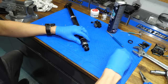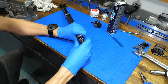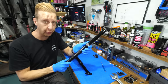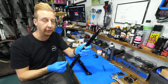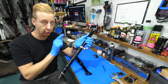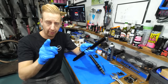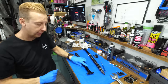Then you're free to put back the remaining parts to hold the cable into the bottom of the post — you'd actually install the cable at this point. That's about all there is to it. It's really quite simple — you just have to take your time and be methodical. You don't even have to go as far as removing all this stuff; you can do option one. But just be aware that the more you do this, eventually you're going to need to take the actual post apart to clean the gunk that accumulates in there. I promise you, your post will feel nice and slick afterwards.